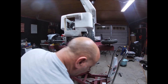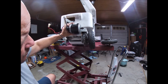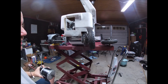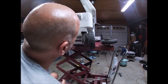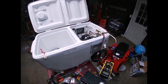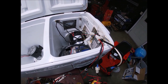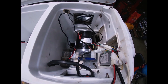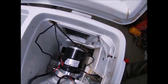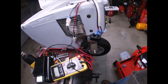I ran into a challenge — the chain wasn't long enough. The 800-watt motor is much bigger around than the 300-watt, so the cog sits about this much higher up, and based on the mounting I don't think there's a way to fix that. We've made some progress: the new 36-volt speed controller is generally wired up, the 800-watt 36-volt motor is in and mounted, and the new 25-pitch chain is the correct length, in and tensioned. Everything's back together — not tight, but back together.